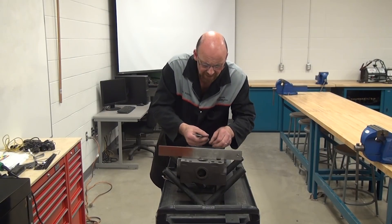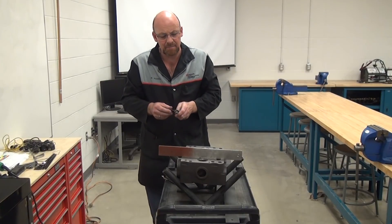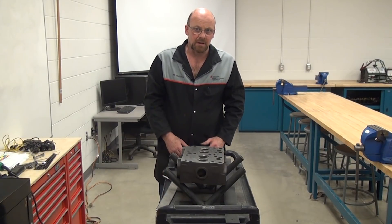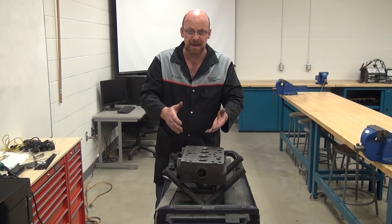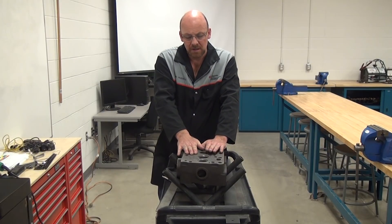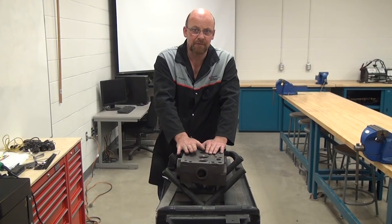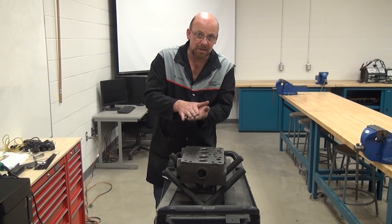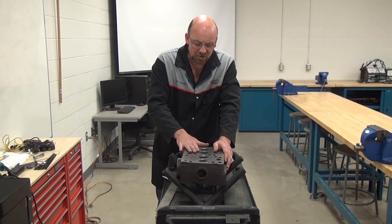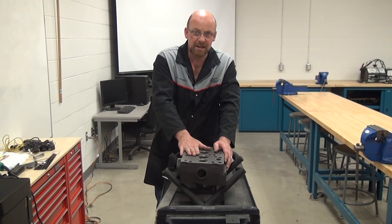Going back down in here and using a flat gauge this time, just to have a feel — holding this down and pulling the strip out — and again, half a thou. I'm not going to worry about that. So this head in particular is a go to be reused. That's some of the information you need for how to properly, one, clean the deck so you're not measuring dirt, rust, and corrosion. If you're pulling this directly off an engine, I'd recommend using a wire wheel to remove any graphite coatings. A lot of manufacturers use graphite coatings on their head gasket materials to allow for embeddability, conformability, creep relaxation, and elasticity — various characteristics of gasket manufacturing to help control small variations in the deck. Just like we found here — half a thou — I'm not going to worry about this one at all. I'll continue on with the other two heads and find out if we have to go any further.